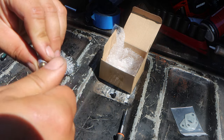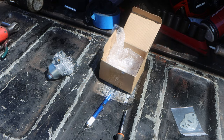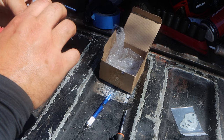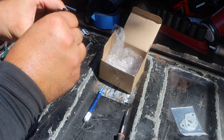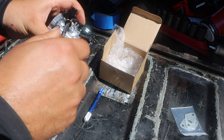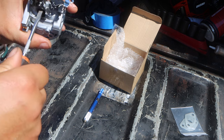By opening this up to the next size, you decrease the chances of it getting clogged up. And just a little bit more fuel, a little bit more performance. Does not have to be done. But I live on an island as well, and the air-fuel ratio — I guess to what, above sea level — is a little hinky. So over time, this is going to start surging anyway, and we need more fuel. If it doesn't happen right out of the box, it's going to happen later down the line. That's for me because I call Long Island, New York home. Put that back in.